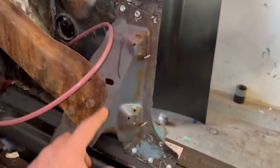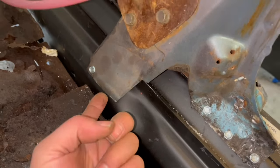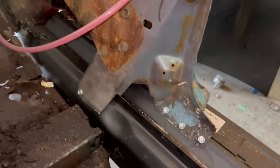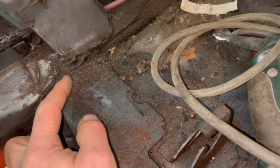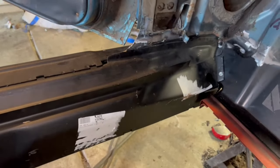On the back, I reinstalled this and put in one, two, three, four, five, six, seven, eight screws. I tied it to here because when I go to do the rear floor pan and frame rails, I've got to move my jack stand over to the rocker panel — I wanted to give it some more structure. The downside is the floor pan has a little raised section that slides up underneath. I may have to either cut or manipulate it. Normally I cut this bottom section off, put my floor pan in, then weld it back in. This brace, being a convertible, comes up underneath there — I'll have to weasel it up in behind somehow. First things first, I'm going to burn that in. Our rocker panel is test fitted and looking great.